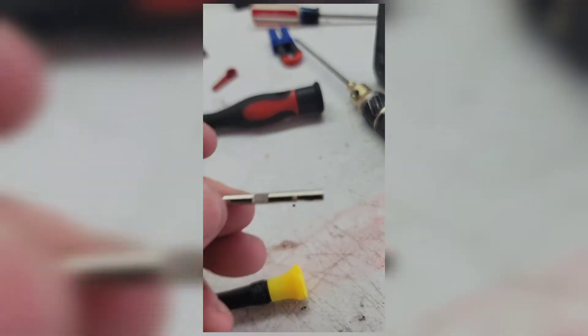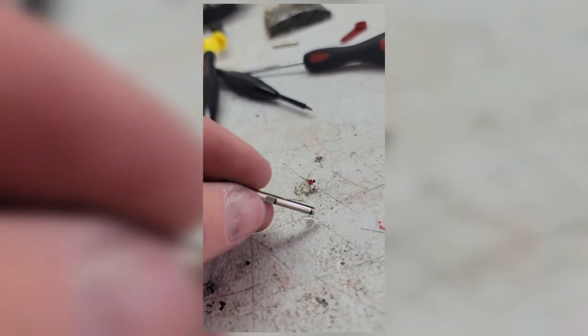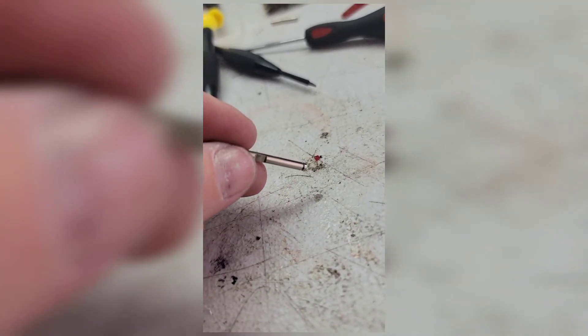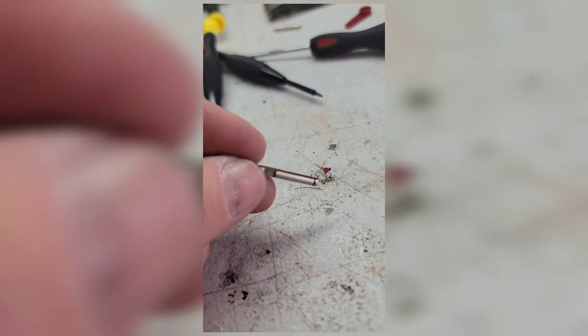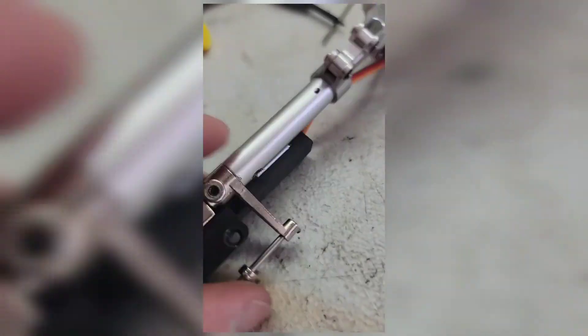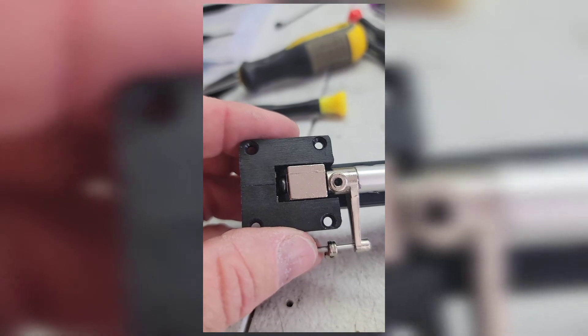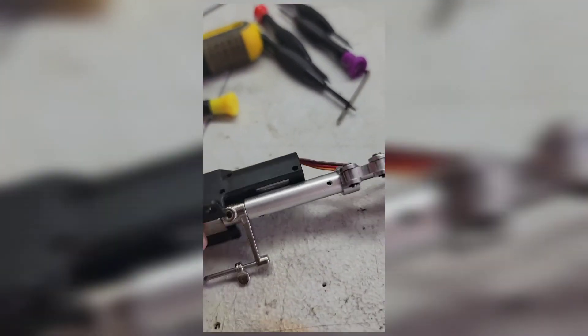Here's the pin from the front landing gear. This pin sits inside here and comes with a little tiny C-clip on one end — I actually had one pop off on a landing and then the landing gear was just flopping around. So once again, same thing with these bolts. You can see inside there — the head of it swivels perfectly fine. I don't need to grind flat spots because the threads collapse like a flat spot.